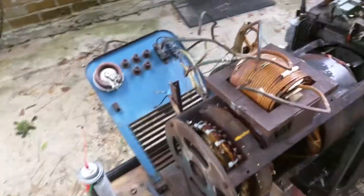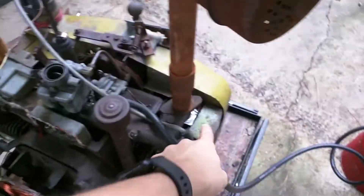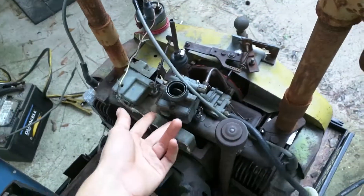There you have it — we got it to run. I don't know if I'll be able to hook power to it yet because we still got some intake gasket issues. The cylinder is not firing — you can tell because it doesn't get hot at all. That and my foil gasket — I'm pretty sure it's gasket issues. Carburetor still leaks, but I think it may work.